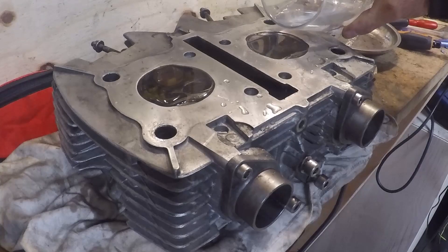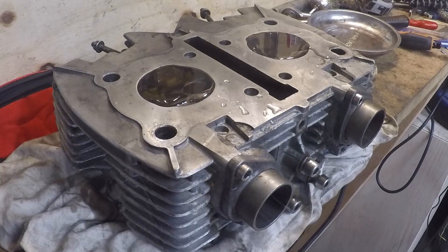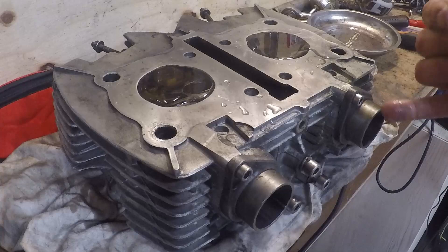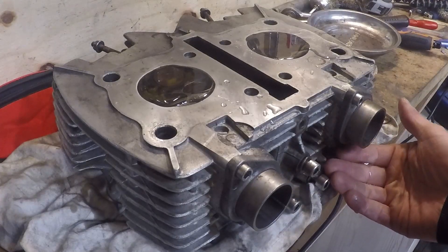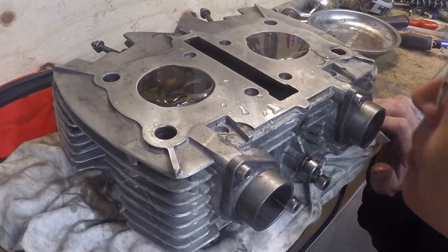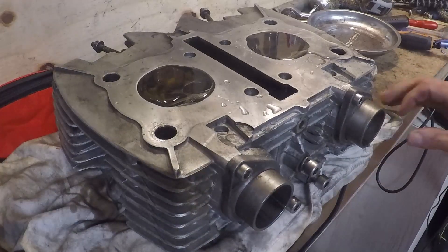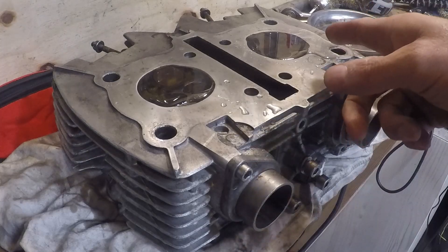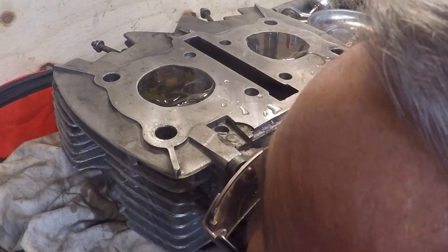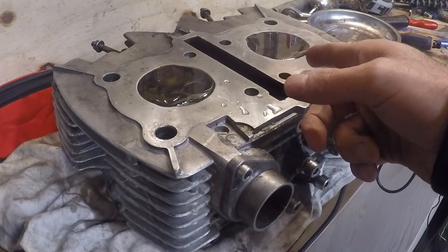So I try a little test - I put a little bit of liquid on here, and this is wet. You can see it coming out the inlet, so clearly the inlet valves are leaking. And if I apply some pressure - there's my problem, I'm forever blowing bubbles. Whereas on this side, nothing. So why has that side failed? Let's have a look.